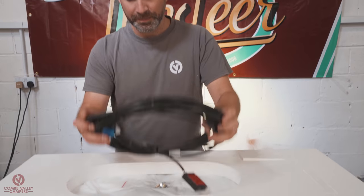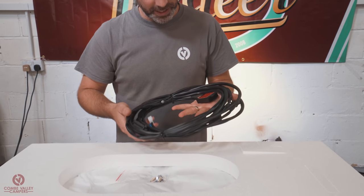From 0 to 25 miles an hour, you'll have full assistance on the steering, make it really, really nice and easy. Between 25 and 45 will be a medium level, and from 45 miles per hour upwards, there'll be little to no assistance in the steering, because as you're up to full speed, you really don't need the assistance for steering correction. So steering loom, really nice manufactured kit.